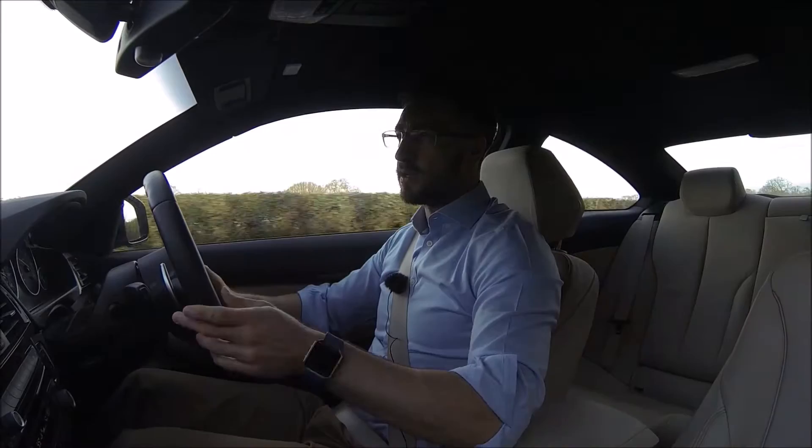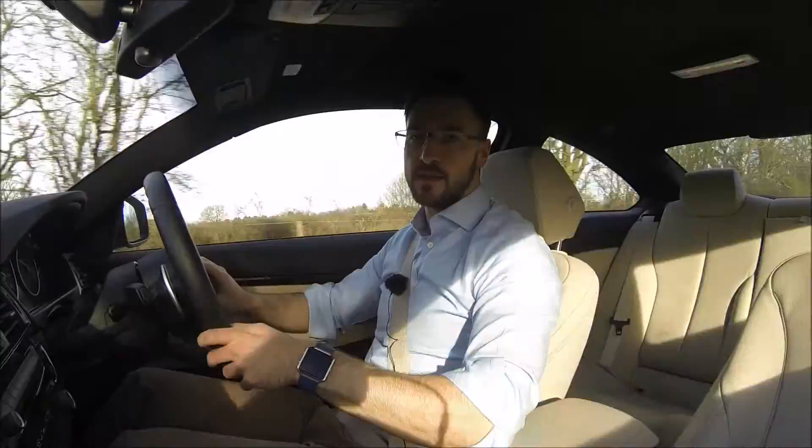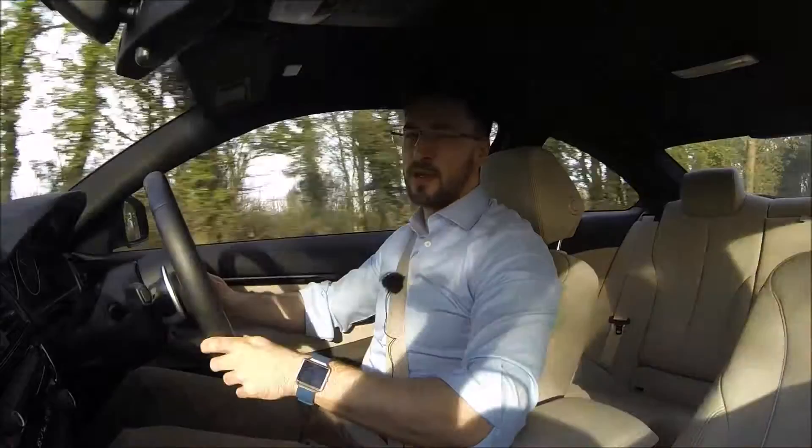It would need a bit of correction going through there, which is fairly hairy given that you're travelling at around 90mph on quite a narrow track. Hopefully you'll also see that I can be a little bit more committed, almost take liberties with it knowing that the rear end is stuck — brake a little bit late to carry a bit more speed into the corners. The video should demonstrate well the change of balance from oversteer without the wing to more understeer at mid to high speeds with the wing.